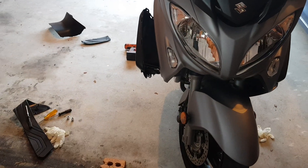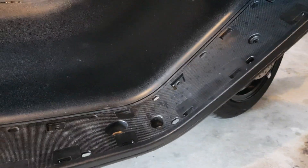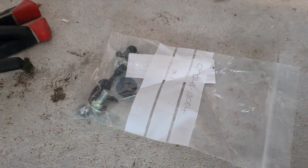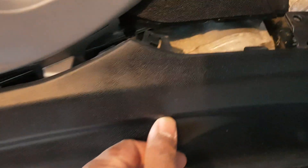As you can see I pulled the tabs and everything out, all the bodywork is hanging around. The first step is to take the middle part out. Once that is out, you rip the footrest. There's a tab up here, a screw here, a tab here, and there's a bunch of screws — some attached to the frame as well. Put them in a zip-lock bag and name it.